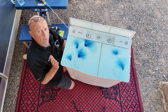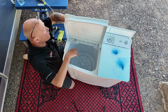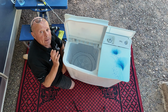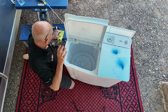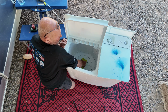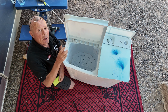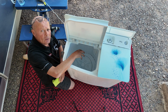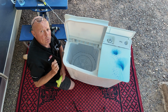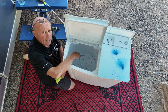Now, when it comes to the wash cycle, there are two common problems that occur. You have the wash plate, sometimes known as the agitator or pulsator, and this rotates clockwise and anti-clockwise while the machine is running. You will see this turning at the bottom. Now, when there's no water in the machine, this may be turning, but if you actually use a pad, and make sure you keep your fingers out of the way, you can lean down and put a little pressure on the inner part of the shaft. If you hear the gearbox grinding or the actual paddle stops rotating, then you either have a problem with one of two faults. The paddle itself has stripped the spline inside, meaning that the gearbox is unable to drive the paddle, or you have a problem with the gearbox itself. This should be rotating clockwise for a couple of seconds, then anti-clockwise for a couple of seconds.